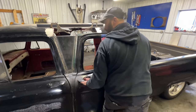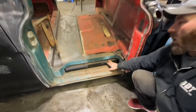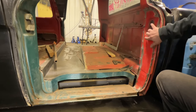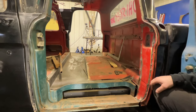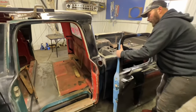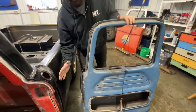The plan is I'm going to put my hinges — I'll just pop this door off right now. All the hardware is still here so the door will sit on there. With my frame being this wide, I needed to cut some of these pockets out. I made the mistake of cutting this out because I was going to put the hinge pockets inside here, but after seeing how a few other people had done it, I changed my mind. I'm going to cut a hole here and here and build my brackets for my hinges inside there, using stock hinges.